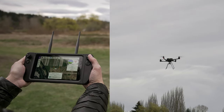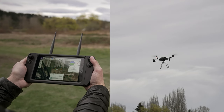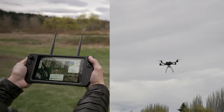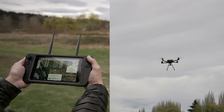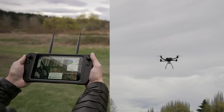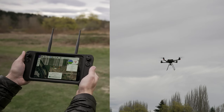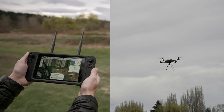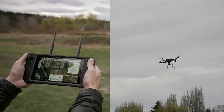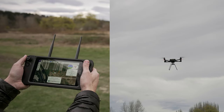It is important to note that flying without GPS takes a little bit more skill. So if you don't have experience with that, we recommend flying on a small indoor drone and practicing without the Alta. I'm going to go back into GPS mode anytime I want just by clicking the GPS button — it goes right back into holding position for me, compensating for the wind drift. And that's the basics of flying the aircraft. Start out slow, just make small inputs, make sure you've got plenty of space as you get to know the aircraft and its handling characteristics.